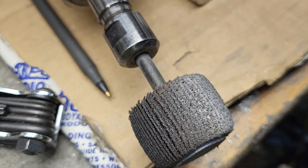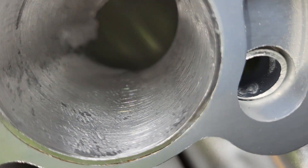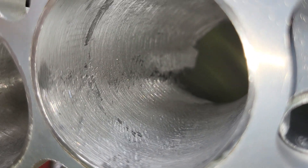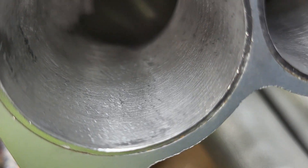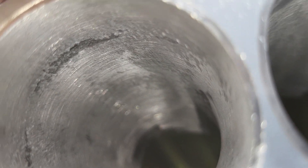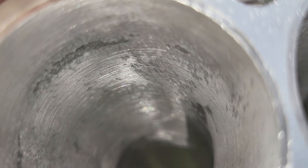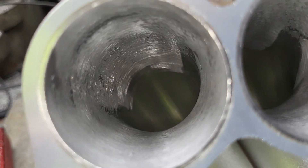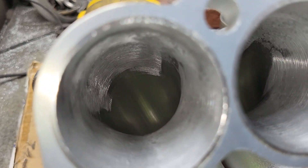Where I hit it with the burr and then hit it with this tool - you'll see some divots in some places, it'll be completely smooth in others. These were all done the same. You can see that spot in the roof - I couldn't equalize it perfectly the way I wanted to, so there's still a change in area there from where the tube gets a little bit larger where it's swedged in. But I did the best I could to make that change in area as slow as possible. We're not going to affect the air much at that.